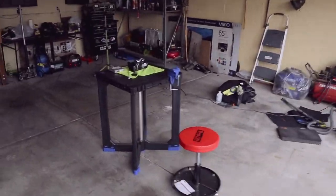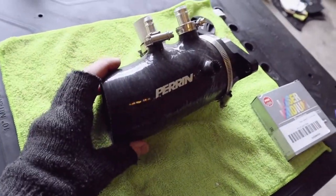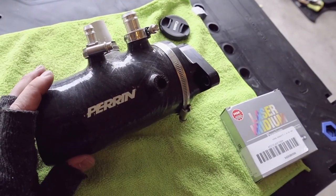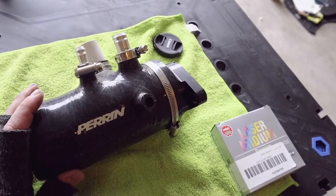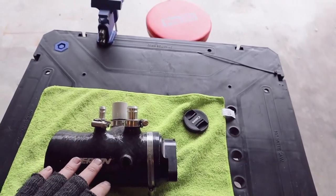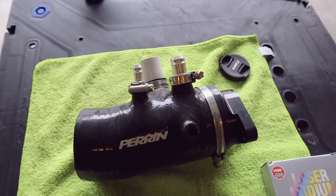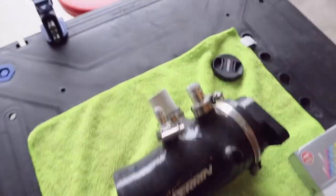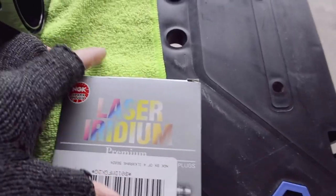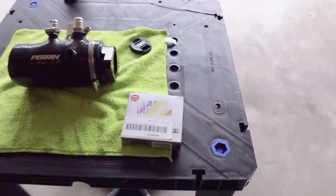Some other things I want to get in place before the tune: after the last tune I actually switched back to the factory turbo inlet assembly because I had an intercooler pipe come off on the way home and the car went into limp mode. My dam level went down a little bit so I was just erring on the side of caution and took it off, but I'm going to put it back in. I might see if I can find a metal pipe coupler that will work better there. We'll also get the plugs changed before the next tune — NGK, which I believe is the same type that comes from Subaru.